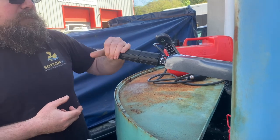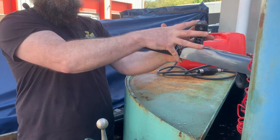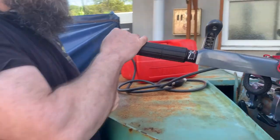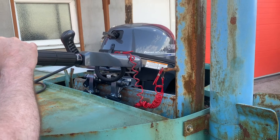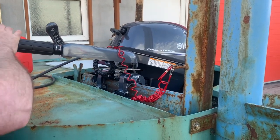Back and forward — for manoeuvring this system is lovely because it's all just here, you don't have to reach round. Then of course you take your steering friction lock off to be able to steer. With a slight amount of friction on, it'll hold; put that on and it's now steering.